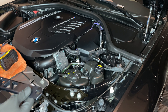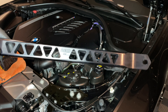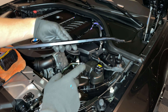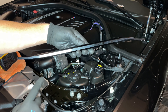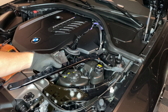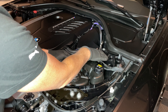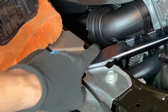Looking at the strut braces — first things first — you're going to want to have the BMS logo facing upwards. Another important part: if you're looking at it from the side and you see it go up and then down at this angle, one side is more flat and then goes down and shoots that way toward the strut brace area. It has to go over and then lay flat, so it'll be completely flush on both sides — that's how you know you did it correctly.